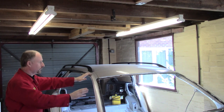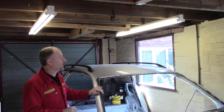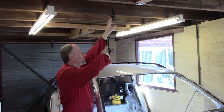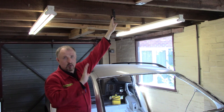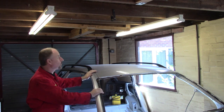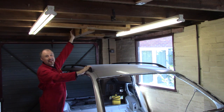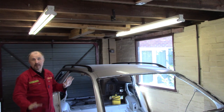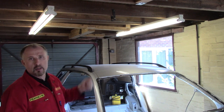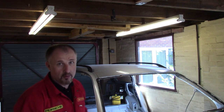The problem is the roof on this one is much longer than the original Ford Cougar. My pivot point — the hook for my ratchet hoist — is positioned for the shorter Cougar roof, so it's not going to work well on this one. I'm going to have to move the hook position over, get the car back in, get it prepped, and then I can chop the roof off.